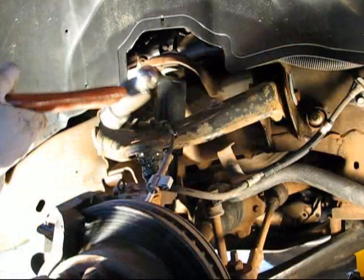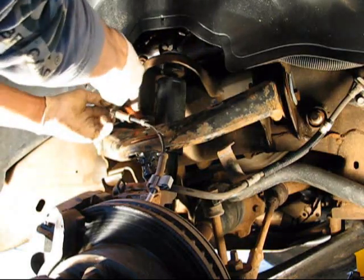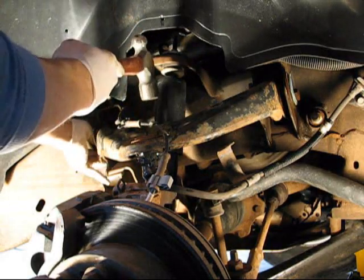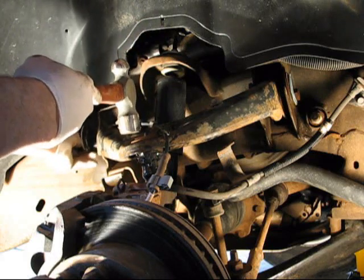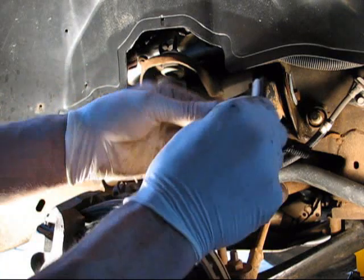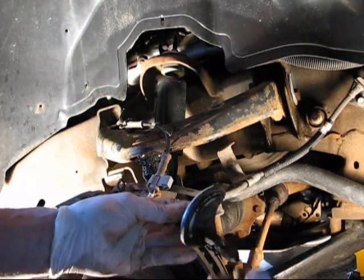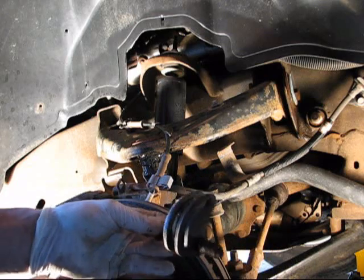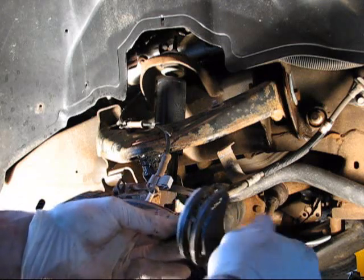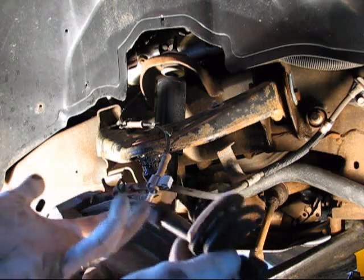When you're pulling these control arm bolts out, you might want to just take your hammer and tap — they come right out. That's the eccentric from the other side. I like to put everything back together on the floor so nothing gets lost. Just drop it down, put it back the way it came out, and you're good to go.